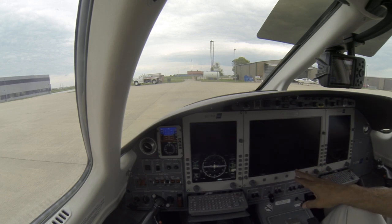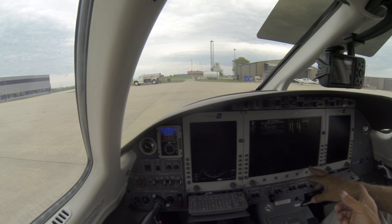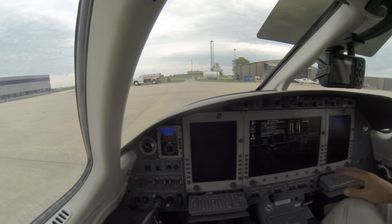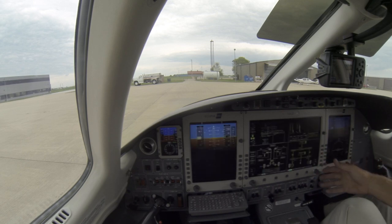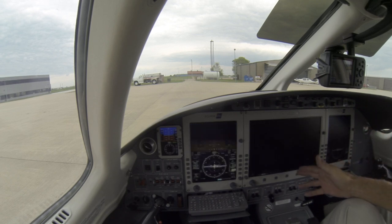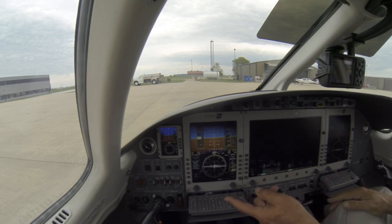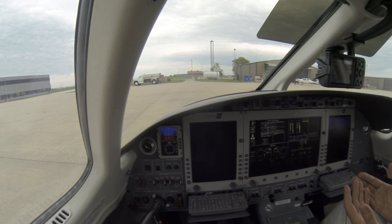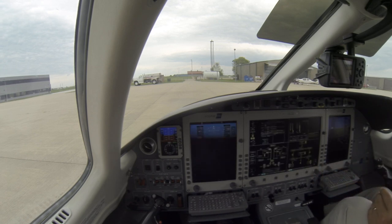Now, once you go to start the other engine, what are you asking of this generator? I was forgetting we're using the same generator again. So we're just going to allow it a little time to cool before we actually induce more heat to make it a super duper generator that's going to put out 800, 900 amps temporarily, and then start that one. And some guys will actually leave the generator switch off to enhance that cooling faster, because with the generator switch off, it's not doing anything but spinning and cooling itself.